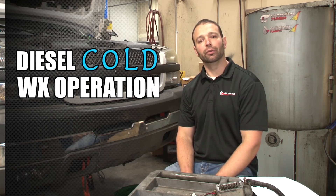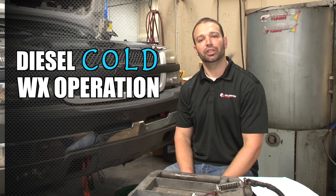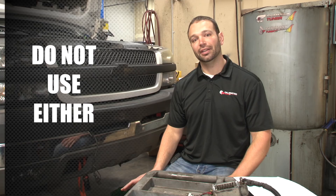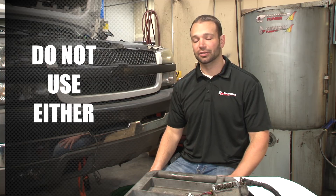My last note is just a couple of avoids. Avoid extended cranking — if the truck isn't going to start, it isn't going to start. You don't have to crank it for a minute and a half to find out that it's gelled. Do something to improve the gel situation before you continue to crank it. Don't risk overheating the starter or the starting system. Save the ether for your John Deere 6030 — do not spray ether into a modern diesel engine. Odds are it's going to run away on you or blow something up. We've got piles of bent push rods and have seen all sorts of nasty carnage from guys spraying ether on these engines. Don't do it.